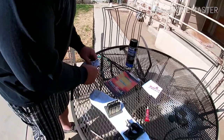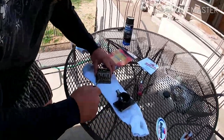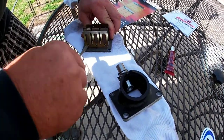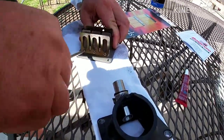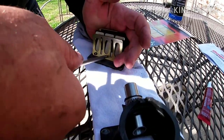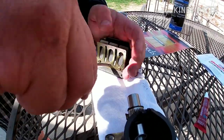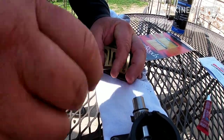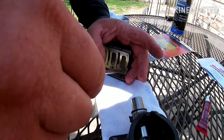We're going to go ahead and install these power reeds, so I need to take out the old ones — making sure we don't strip the heads off of them. I'm taking note of how tight they actually are. These look like they have never been out of this bike.